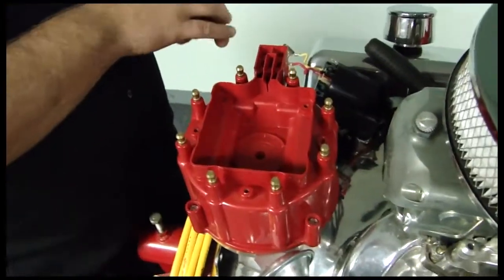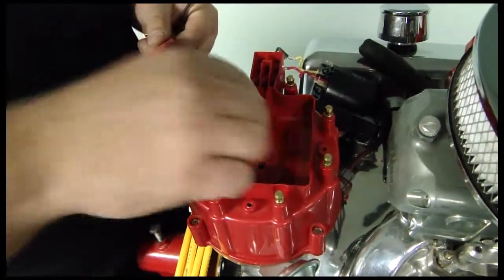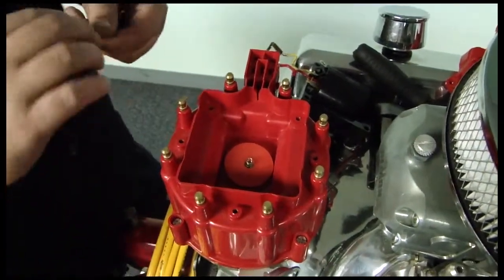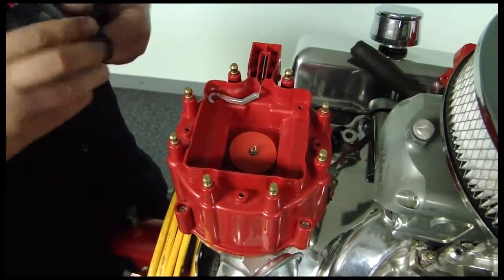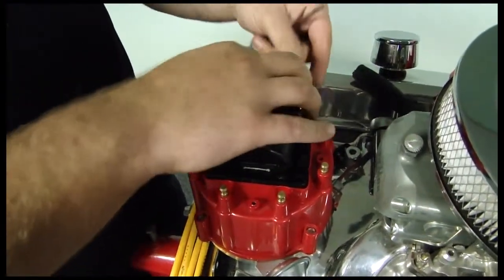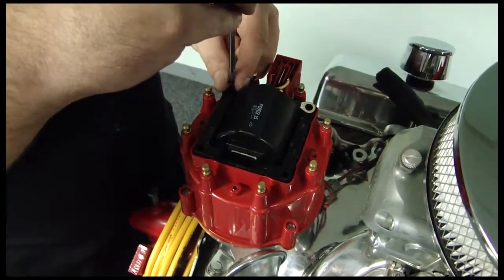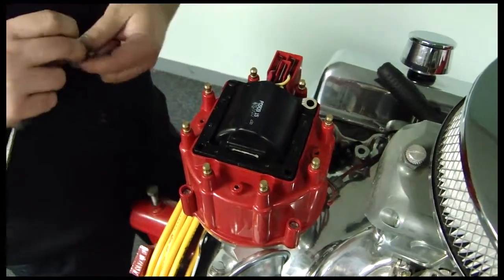Next thing to do would be to put your coil back in there. Don't forget to put your carbon brush, which will sit right in there. And then a little rubber washer, and you can put dielectric grease on there too — that'll help from the spark leaking out. Put your ground strap back in. Coil — make sure the contact's sitting on the bottom; that only goes one way. Sits right on there. Coil positive back in. Coil negative back in the little slots there. And then you can go ahead and screw your coil back down into the cap. And that's just four happy little screws that go in there.